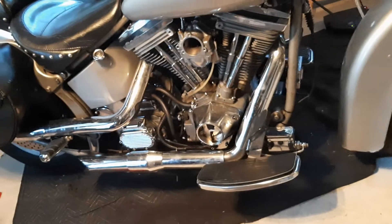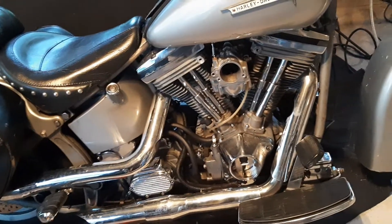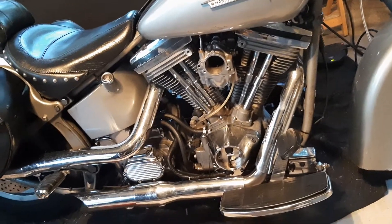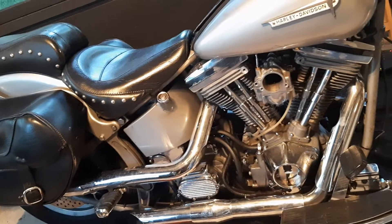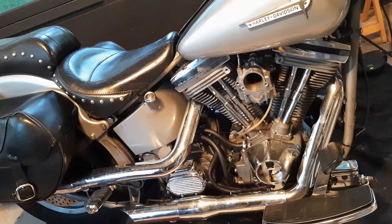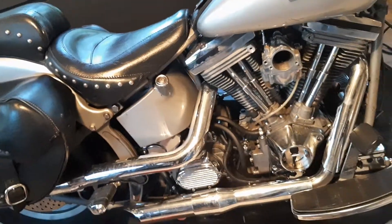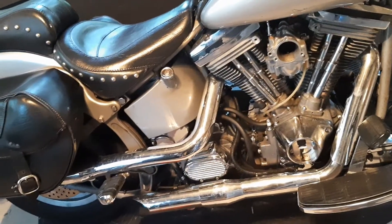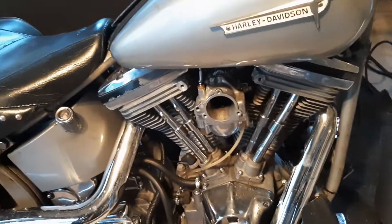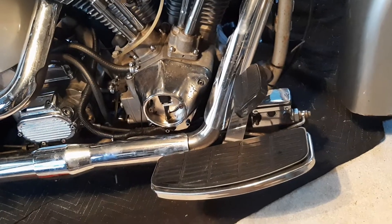It's between the timing and the carburetor. I've done a factory setting on the carburetor — it'll crank up and idle, but when I start going down the road and get on it a little bit, it'll break up, spit, and pop. I already put new intake manifold seals in there, tested it, no leaks. The carburetor has been rebuilt — it's an SS carburetor — so I'm dumbfounded on what it is.